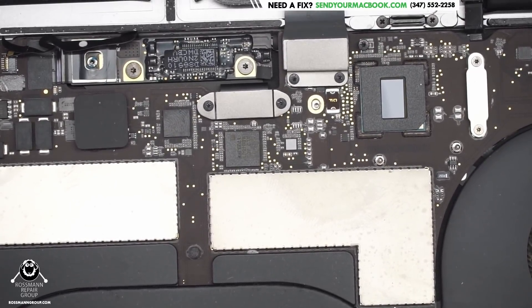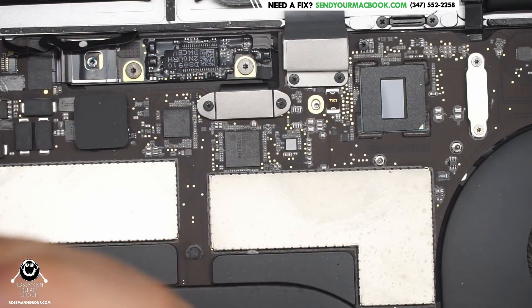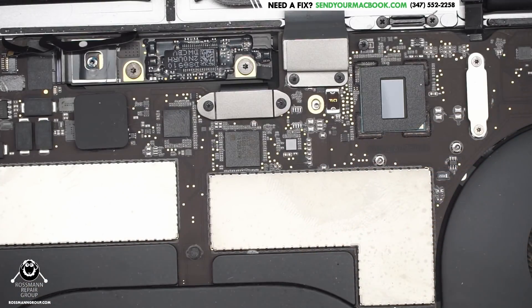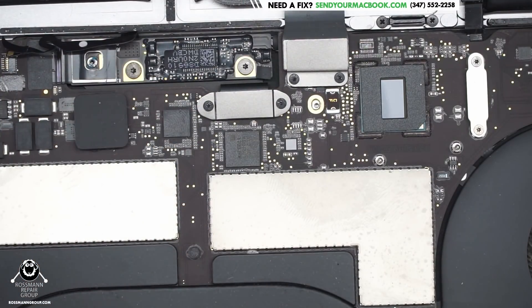There we are at full zoom. I think you should be able to see what the problem is at this point. Daniel Oliveira wins — screw in the connector. This is not where a screw goes. What is this connector that has a screw in it? A little piece of metal that's going to short all the pins together. We are going to visit and see what that is in the schematic and the board view. I'm going to open up a schematic for an 820-00928 board as well as a board view and we are going to see what that connector is for. That's J6100.